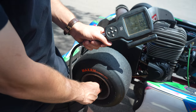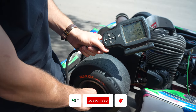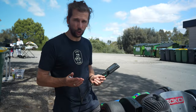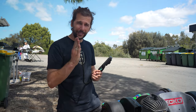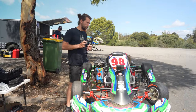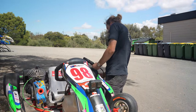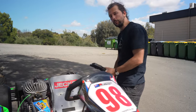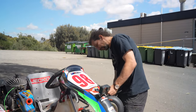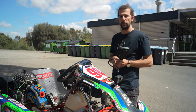We've got our reading here on our digital tyre pressure gauge. As you're letting out air, you can get 0.1 increments down. When you go to an analogue tyre pressure gauge, you can't be as precise — it's still got the dial going down, but it's not going to give you the 0.1 to 0.3 increments that you need. If you want to get more involved in your tyre pressures, you can actually lower the rear tyres a little bit more in pressure, because they attract more heat, especially in a go-kart. So you can have the front tyres maybe 0.5 PSI more compared to the rear tyres.